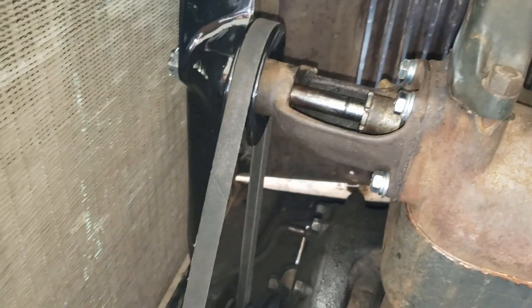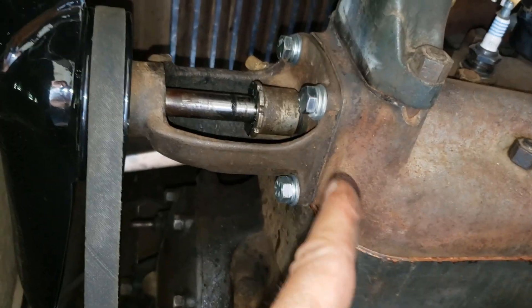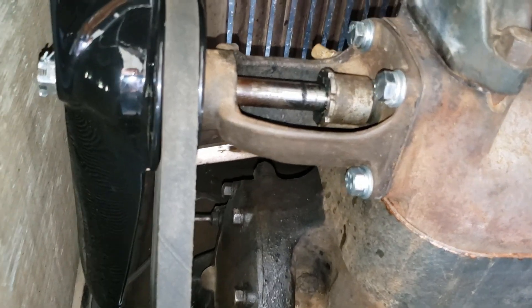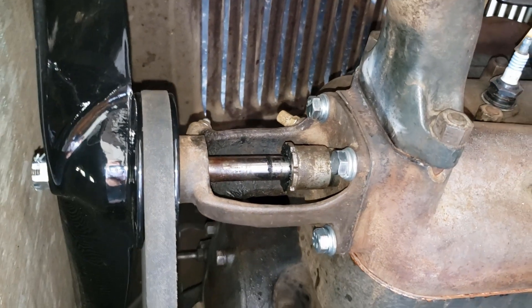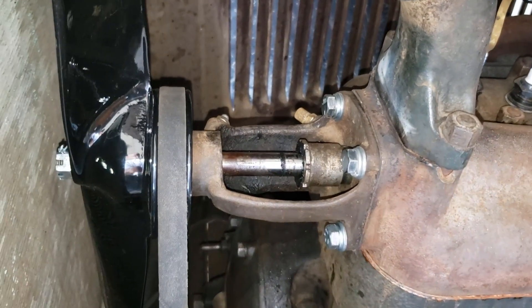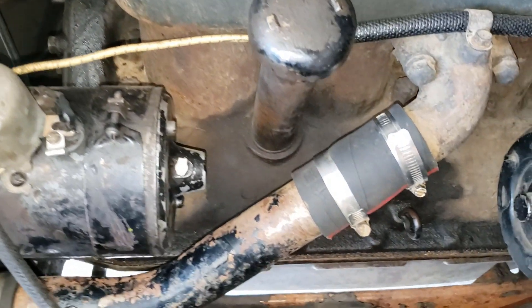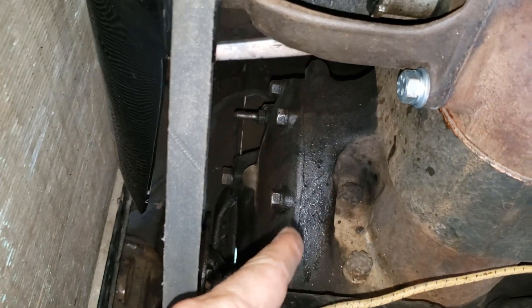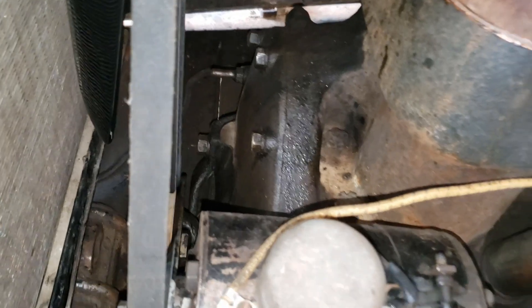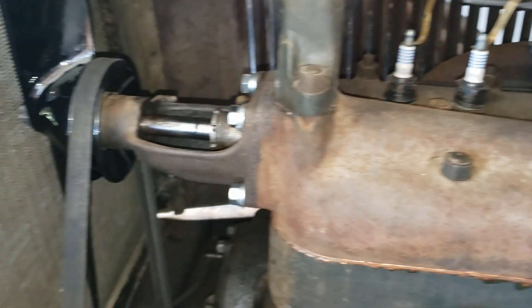Here's the installation of the new aluminum fan. You can see the new bolts in instead of the studs, so if I have to service it I can just pop out the bolts, move the radiator forward a little bit, and take it out. The studs being longer really require moving the radiator further out of the way. So far so good — I don't see any leaks. I'm going to continue to look a little bit more; there might be something down here, but overall I'm pretty happy. No leaks along the hoses either. I just have to hook the lights back up.